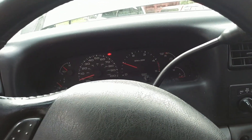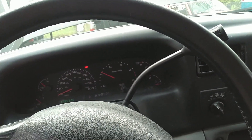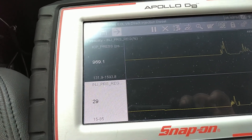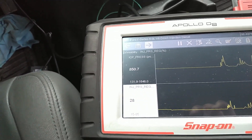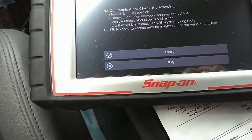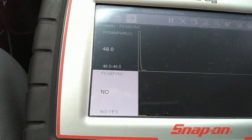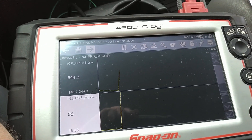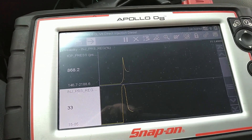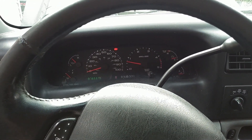Let's see what it does - it sounds good! This truck runs amazing. If you didn't see the first video, that's 376,000 miles on what appears to be the original engine. Our rail should be primed now. Cycle the key - let's watch the IPR. Fires right up! Alright guys, I'm going to let this thing run, get up to temp, top off the coolant, then take it down the road and make sure everything's good.